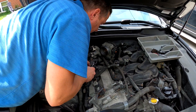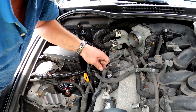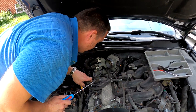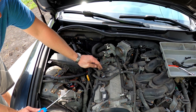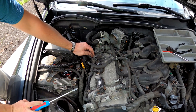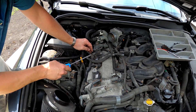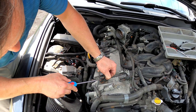It's got another harness for this sensor in here, and in the back it's got a little sensor too. I'm gonna see if I can pop this one out. I don't know what that could be but it's another sensor that seats in the valve cover — maybe a noise sensor or something. It's more likely closer to the crankshaft. We're gonna remove that electrical harness first, so let's pop all the sensors off first.